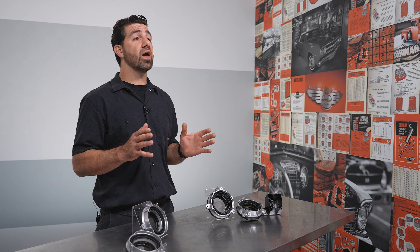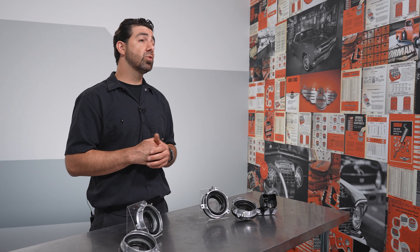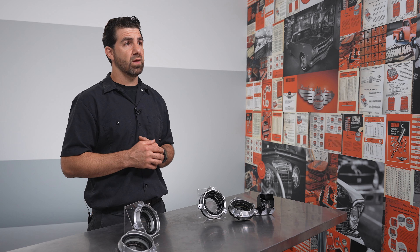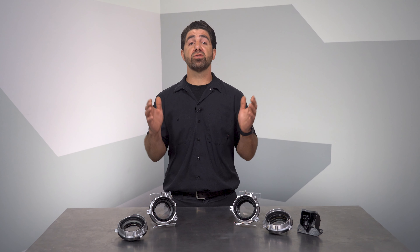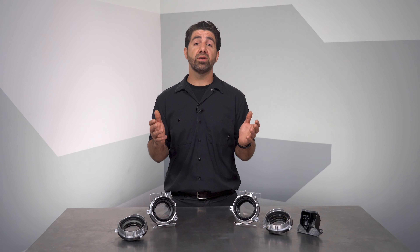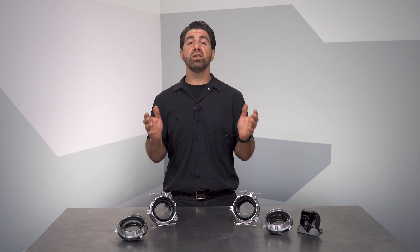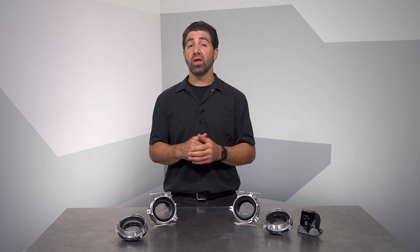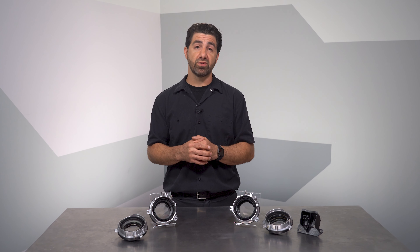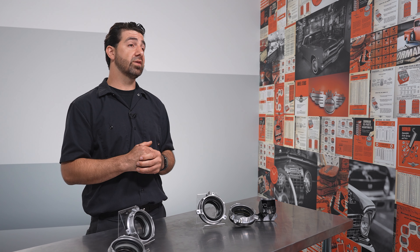If a gross leak is found, the wheel hub will be locked. But normally, the failure is gradual and vacuum is lost slowly. This manifests itself as a grinding noise when slowing or turning. The slowing of the engine causes reduced vacuum, and the power steering pump at low engine speeds can cause enough of a drop to partially engage the wheel ends, leading to grinding as the teeth on the wheel end begin to engage the splines on the driveshaft. If left unchecked, this will eventually ruin the wheel end actuators.